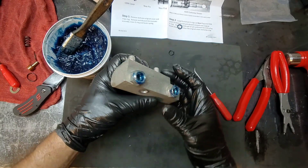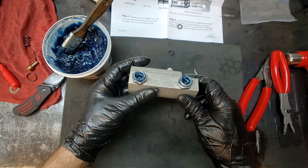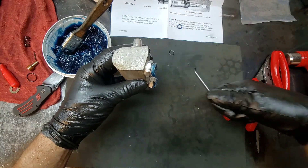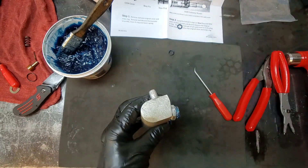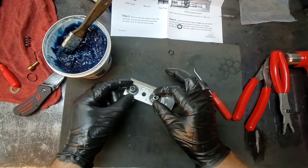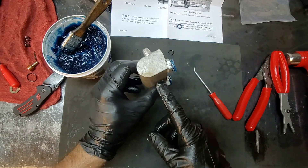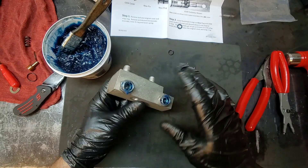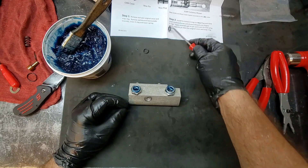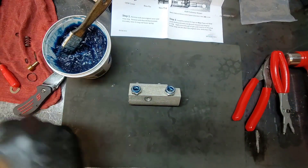When you bolt this up to your transmission with the cooler lines, you don't have to struggle with the clips while holding the line. You do it like this beforehand — install the clips on the fitting, then push your cooler line in and click, that's it. The transmission has new seals; the bell housing takes two seals that get sealed up when you tighten the bolt. These two old o-rings are not the ones we just installed — don't get confused.